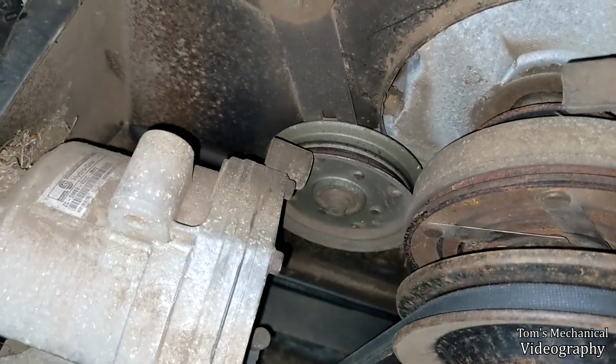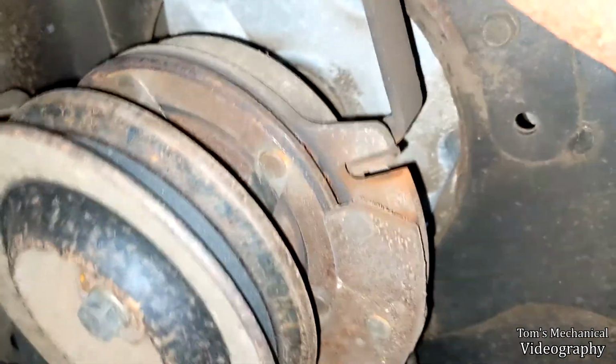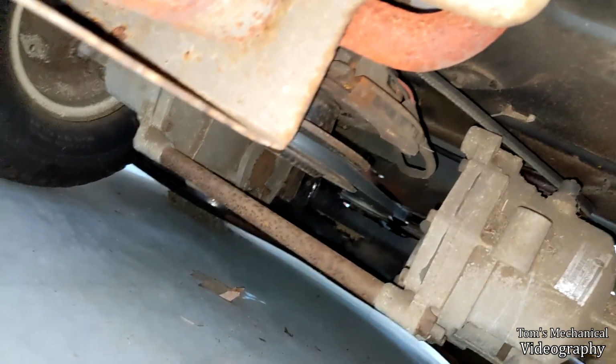And I looked at that, and it said to change the transmission belt, you loosen the idler, slip it off the idler, and then pull it out, put the new one in, and then put it on the idler. And it makes no mention of this or that harness wire. So that's interesting. Or the fact that you have to take the deck. Actually, I think it does say take the deck belt off. But, you know, yeah. Also, I have to take the deck belt off.